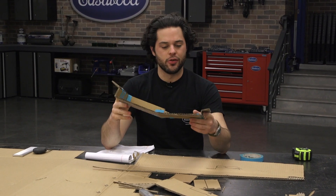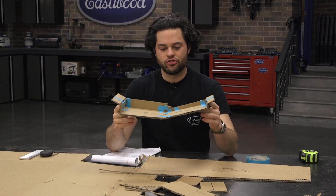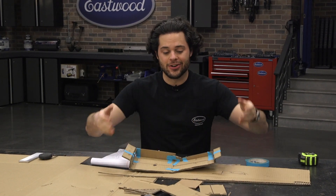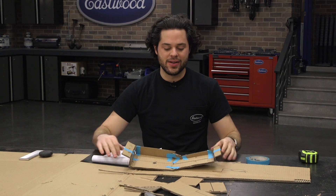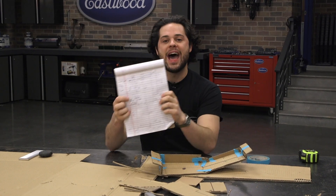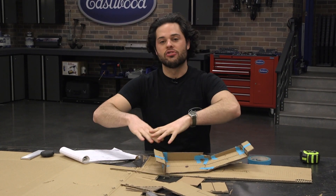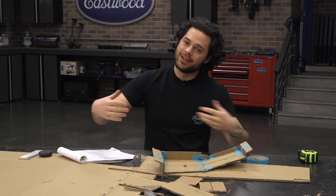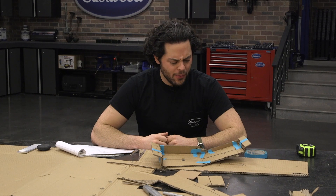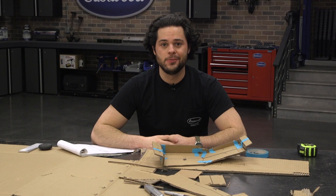Here it is — about 90 minutes worth of work holding the cardboard up to the bike and getting into what we think is going to be our final shape. This is just a rough cut; you start with a lot of material and cut it all away. But we have the exact measurements on this sheet of paper. Once we flatten this out, we can transfer this to a piece of metal, cut that out, get the sheet metal brake, bend it into shape, weld up the edges, get some holes drilled in for the mounting points, and we'll have an electrics tray that fits to our bike and just needs paint.